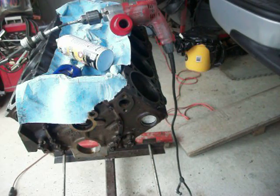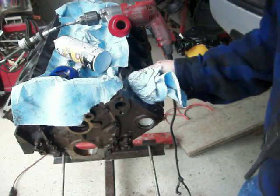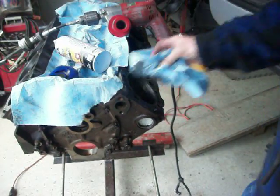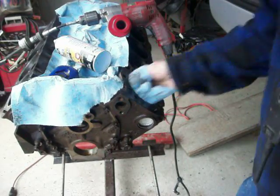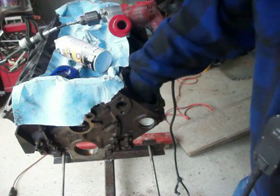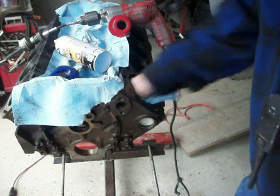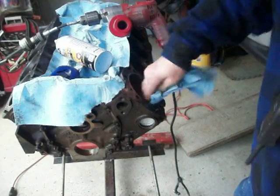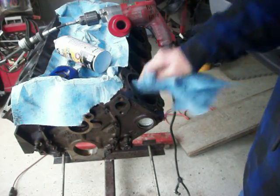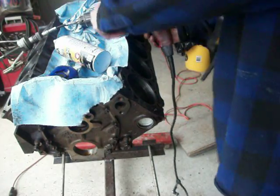You also want to clean the cylinder. I had oil inside these cylinders before I went into the house last night, so that it doesn't rust. So dry the cylinder with a blue paper towel — everybody seems to be afraid of lint, but all you can do is keep your eyes open and watch for it. You dry that off good until you're barely getting anything.